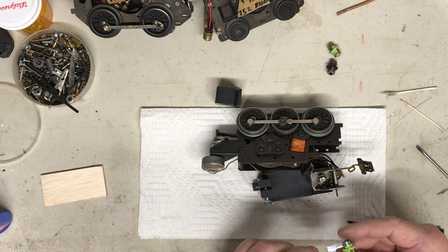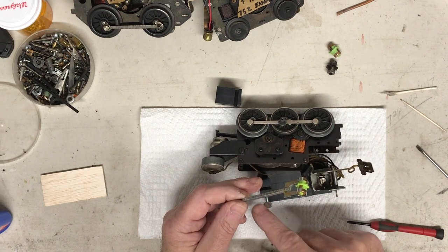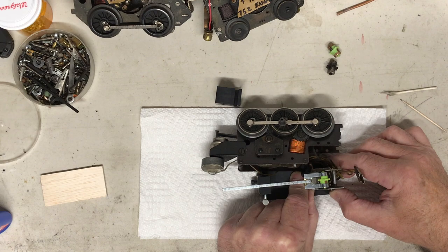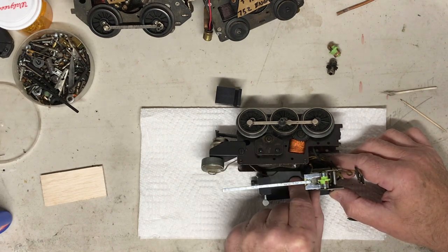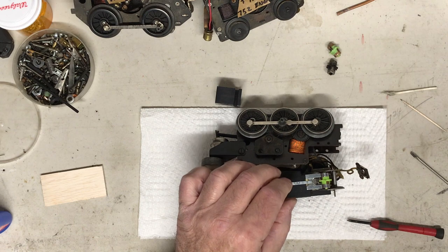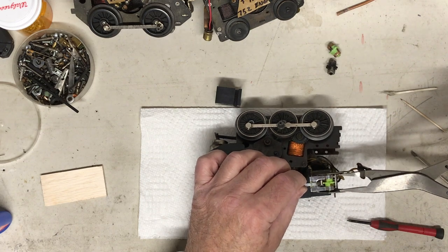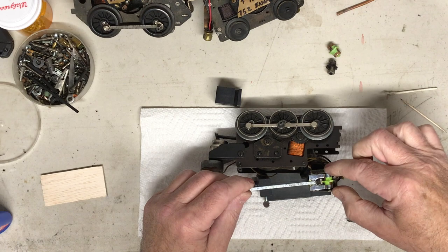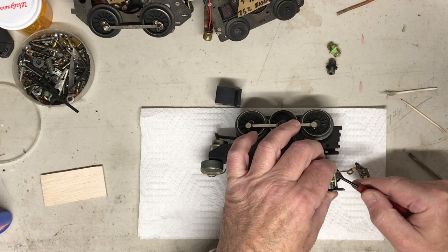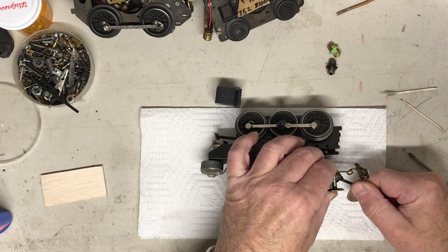So we're going to pop that in. This is how this works. There's an adjustable nut here. You get the square in here. Move the E unit over a little till it's lined up well. And then you get that down in here. Get a little bit of open on here. Get that down in there. Get the holes lined up for the E unit. This has to go back into place. And it looks like it has to go up a hair. There, that's starting to go.